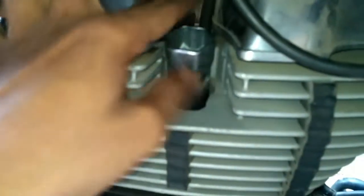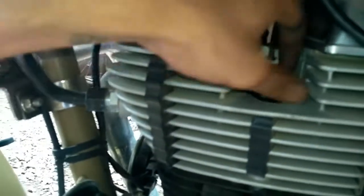Now it's open. Just rotate — it's a long way, have some patience, it will slowly come off. The best thing about removing the left spark plug is there's lots of space here compared to the right side. I can't fit my three fingers on the right side, but on the left side I can put my whole hand in, so it's much easier to remove the spark plug.